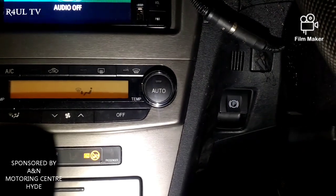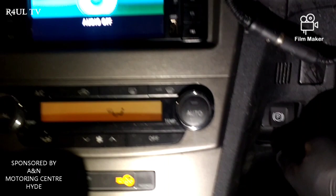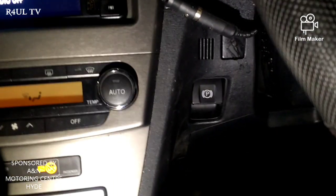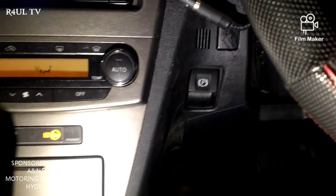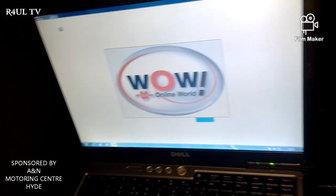The first thing we're going to do is turn the ignition on, press the brake, and release the handbrake. The handbrake is released. Now I've plugged the laptop on and I'm going to put it in fitting position. If you haven't got the brake pads in stock, I suggest you wait until the brake pads arrive — you don't want to leave it in replacement mode for a long time. If you do, keep a battery charger on it so the battery doesn't go flat.